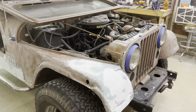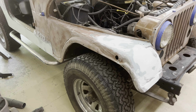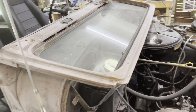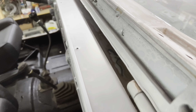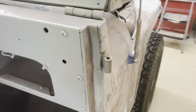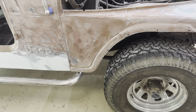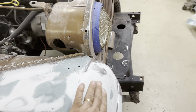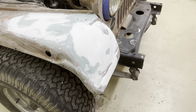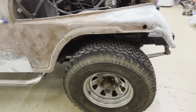After I got done priming the hood and the two doors, I spent the last several hours doing some detail sanding. I sanded the entire window frame with 220 on both sides, plus lots of little odds and ends — places that needed at least a scuff sand so the primer will adhere. I also went ahead and sanded back the filler I had added to try to create more curve, as well as both sides with 120.